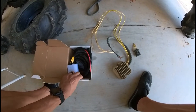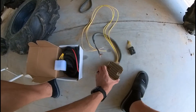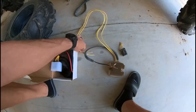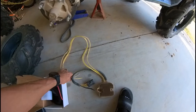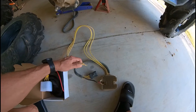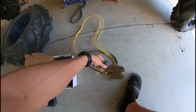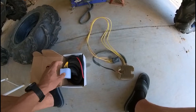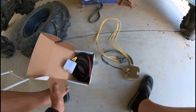Here's the new voltage regulator I ordered from Amazon — I'll do a comparison for the Polaris Sportsman 570. This is the old one I took off. I cut the plug on it so I could pull it through — there's a rubber boot you pull it through when you take the old one off, instead of getting in there cutting wires on stuff I'm keeping. I knew I wasn't going to use this anymore, so I just cut it off and it slid right through.